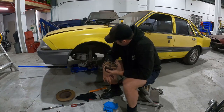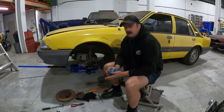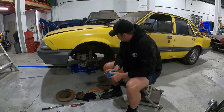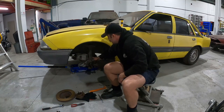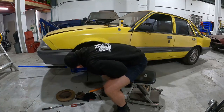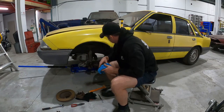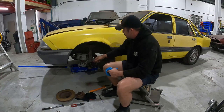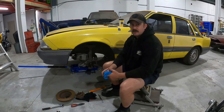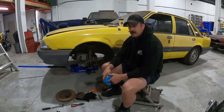It's pretty much that simple - swap the lines, that's it. For the other side I'll just pull the whole strut assembly with the lower control arm and all that together. To get the rest of the strut out I need to disconnect the steering rack, disconnect the sway bar link, disconnect what they call the Z bar or S bar, undo the lower control arm inner mount, and then undo the top of the strut - just three bolts at the top and the whole thing will slide out the bottom. I'll clean it up and give it a paint to make it look a little bit pretty before throwing it in the other car.